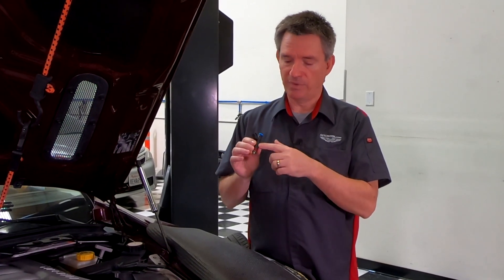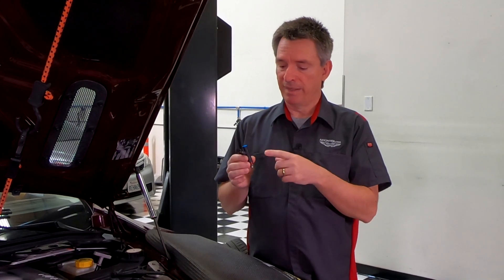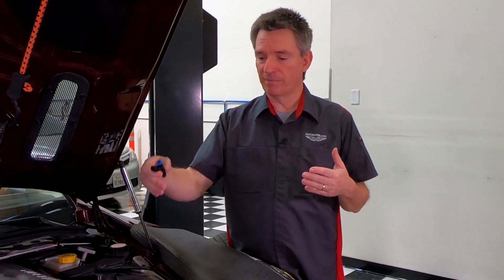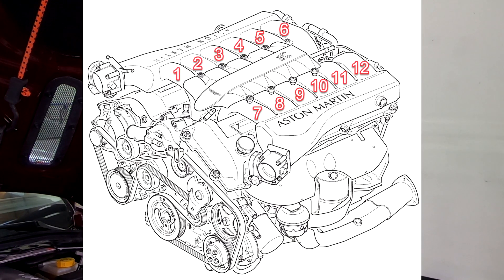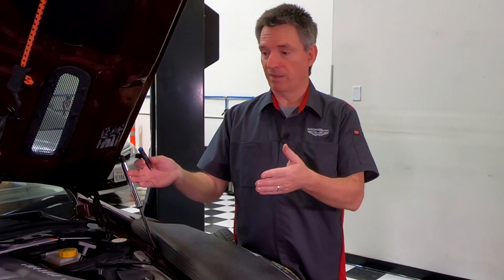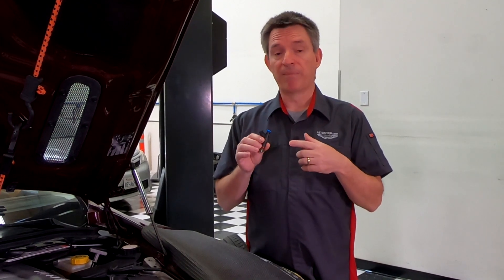My car is going on 17 years old — it's just about ready to graduate high school. Inside the engine are 12 fuel injectors, one for every cylinder, and these things can begin to deteriorate with time. I've been chasing a misfire and lumpy idle situation, doing my plugs and coil packs. I also had a lean emissions condition on cylinders 7, 8, and 9, and I wondered if my fuel injector could be causing it. So while I had my car apart, I decided to take a closer look at my injectors and figure out how to check, inspect, and refurbish them.